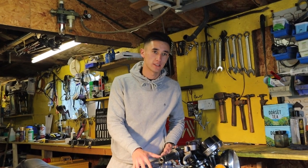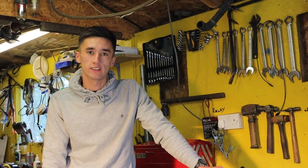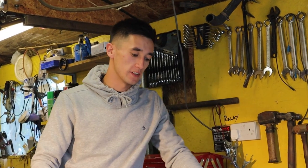So in this video, we're going to completely take the carburetors out. We've ordered a carb kit online with new jets and new seals. So what we are going to do now is completely strip these carbs down, have a good look at them, and clean them all, getting rid of any old fuel, any old oil that may be in them, and all the old seals. Then we're going to put new seals and new jets in. And then hopefully, this will be a nice little good one.